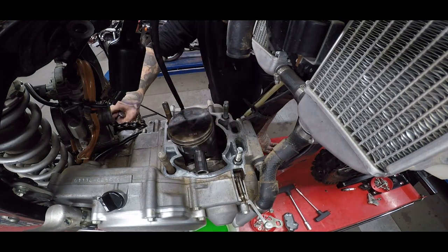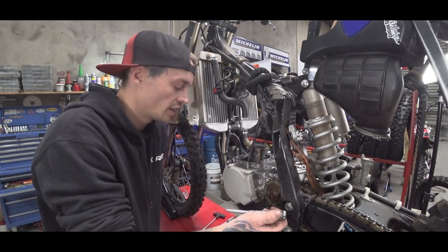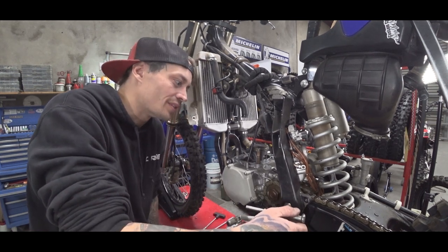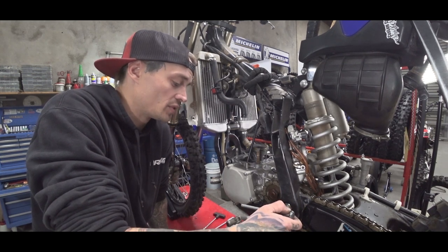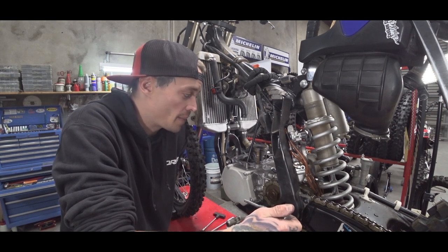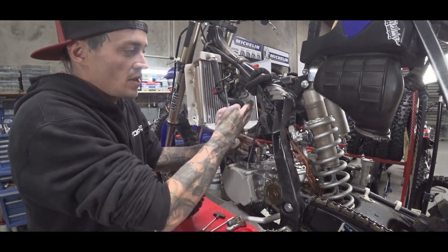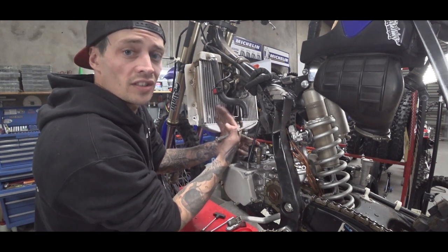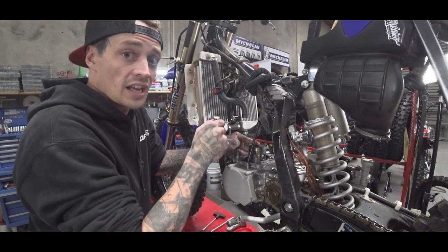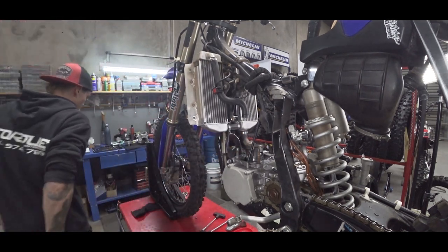Circlip one out — it's a little bit jammy because of all the oil, sometimes causes friction. I had to give it a light tap with a hammer and punch. It's not really something I'd recommend but sometimes you've got no choice, so if you've got to do it be very very careful. Keep in mind what's going on around there — remember the rod needs to be down and the piston sunk down. Light taps, because we don't want to put pressure on the big end bearings down in the bottom of the motor.